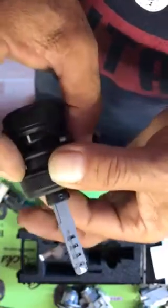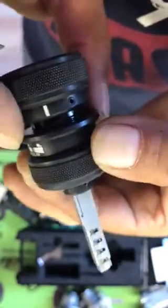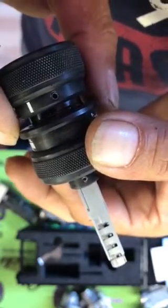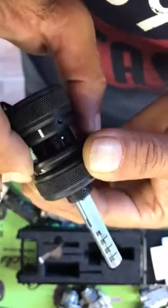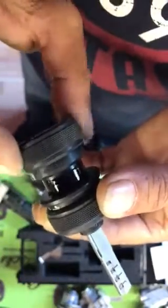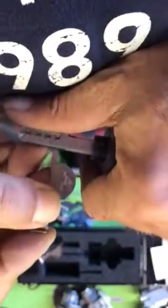I'm the inventor of this device and I'm going to show you how to apply the procedure. The first thing, you have to reset the pins. The pins slide into each other; when they get the code, it makes it possible to lock or unlock the lock. To reset the pins, go forward with this wheel, turn the back wheel completely to the right, and keeping the tool like this, go in those holes which are at the side of the keyblade. Inject that needle here and push.